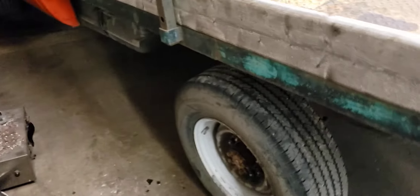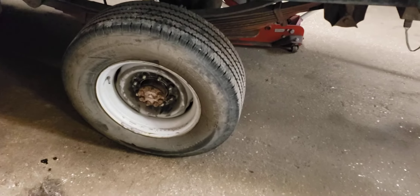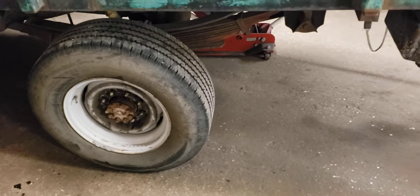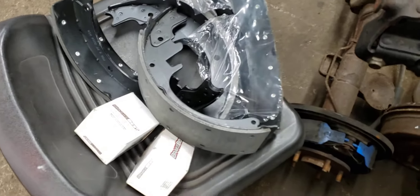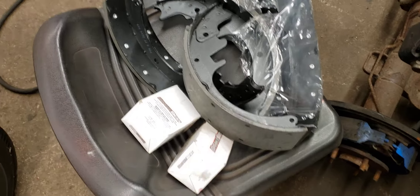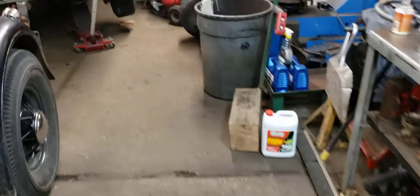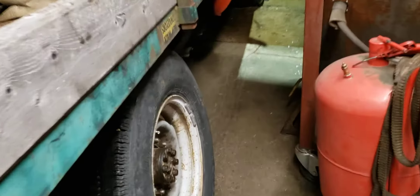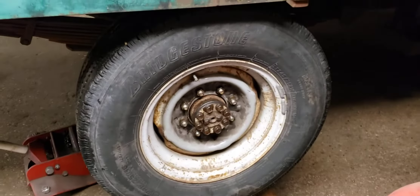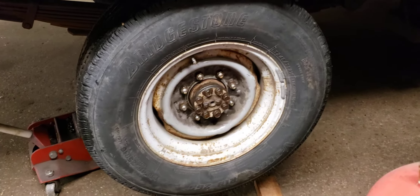When I rebuilt the truck I put all new brakes in — everything got rebuilt. I bought new brakes and everything for it last year, but when I put the lining up next to what was on there, there's hardly any wear, so I wasn't going to put new ones on just for the heck of it. I'll put those in stock. The outer wheel bearing on this side was junk once I pulled the hub off — that explains why the hub was always a little warm when hauling stuff. New bearings, new seals, new drums, new studs.